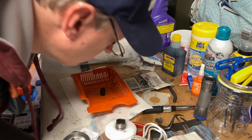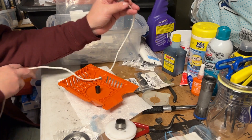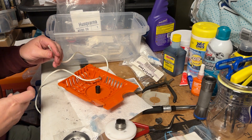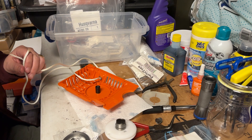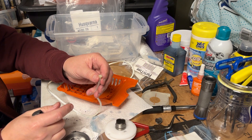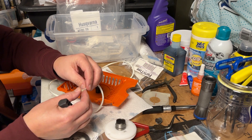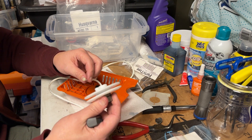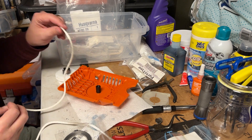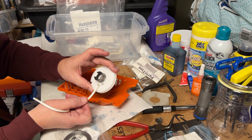The first thing I'd recommend doing before you forget is to pop your cord through the sleeve — make sure you do the correct end. For different sizes of this generation, the 200-series and I think even the 394, the ends that fit around the pulley are different. Some have this mushroom where they melted the nylon cord. You need to know which saw you're dealing with and approach it correctly, because on the 281/288 you can't just bring a line through and tie a knot.